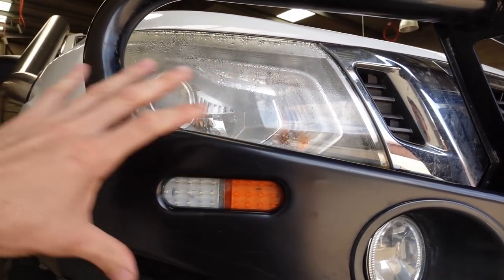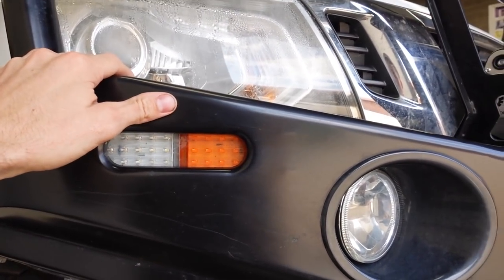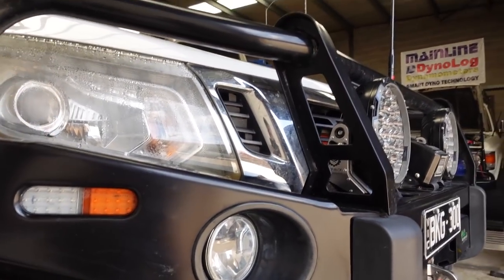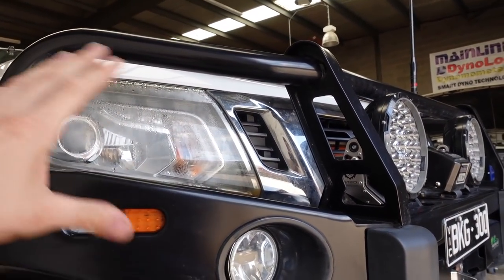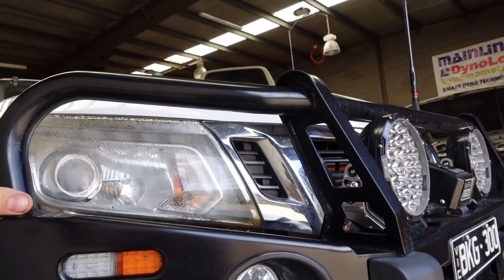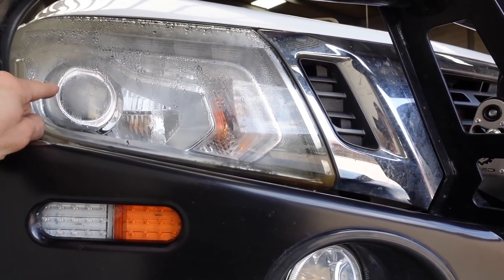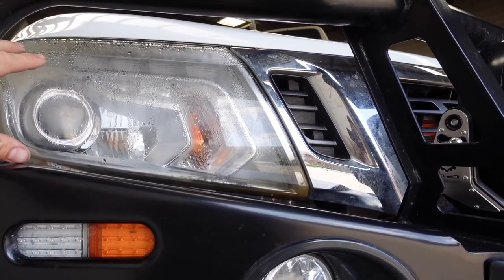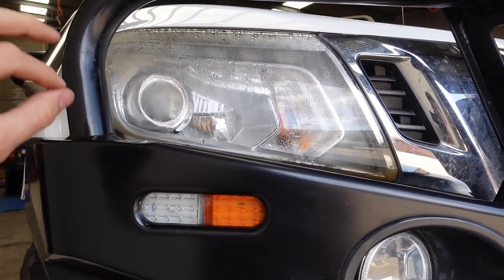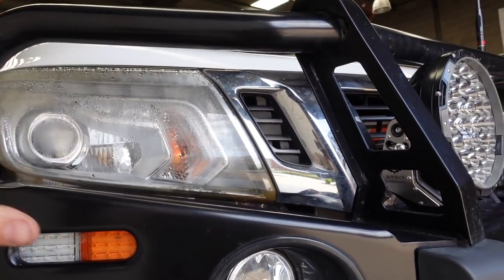That's probably due to how tight a fit I made the bull bar — I made it nice and streamlined and tight fitting because I wanted that look, but it was probably a little bit too close and didn't allow enough flex when it cops a hit. So I'm going to remedy that today. This has created an opportunity to black out my headlights, because I need to pull this lens off and try to repair it. I also need to clean that cover — it's got muddy off-road water sitting in the bottom. It's also stopped my projector headlight from working due to condensation and water getting in there.